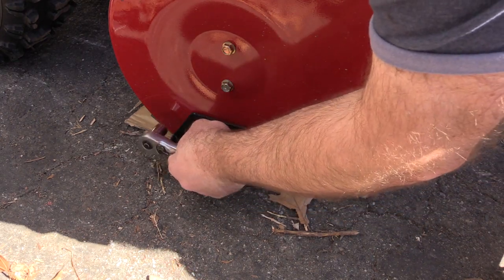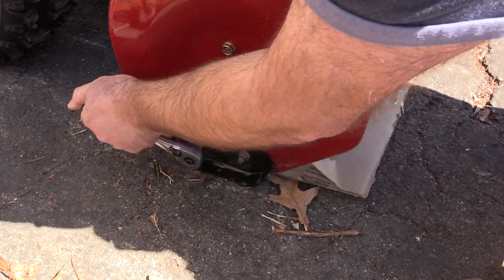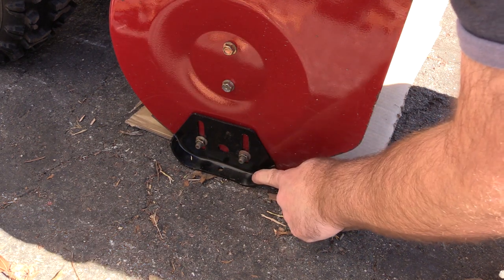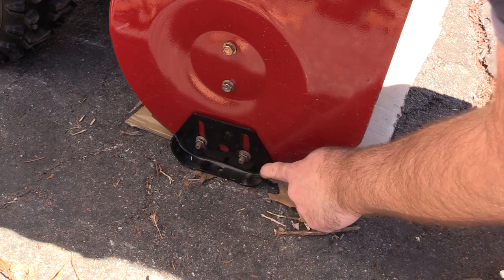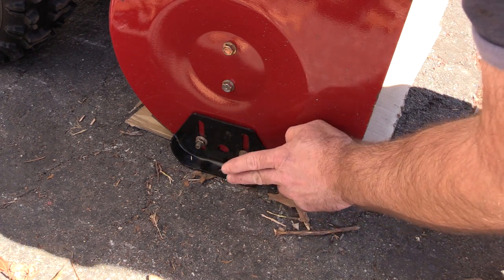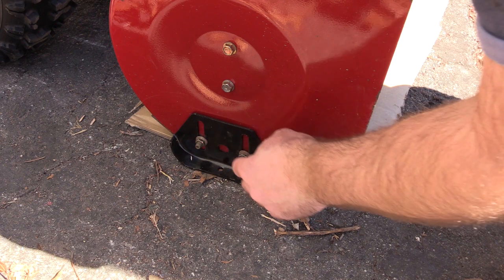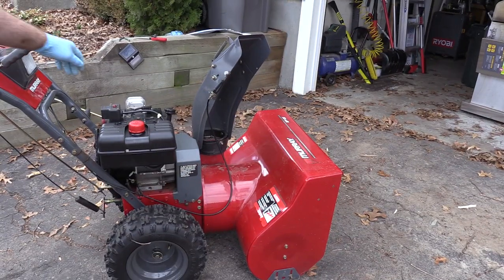As I mentioned previously, the proper way to adjust is: stick a thick piece of cardboard underneath — not wider than the scraper — to basically hold the scraper off the ground enough to adjust the skids. Tighten both sides up loosely, then once they're gripped tighten them the rest of the way. These were $25 original Briggs and Stratton parts shipped on a Sunday from the post office. You can get them off eBay for $7 but with $3 shipping, so I figured I'd get the original and spend the extra few bucks for quality.